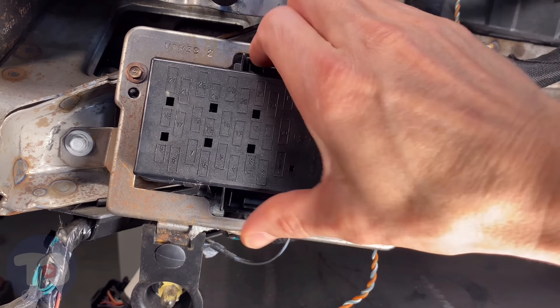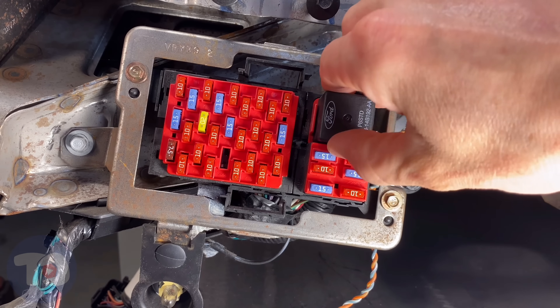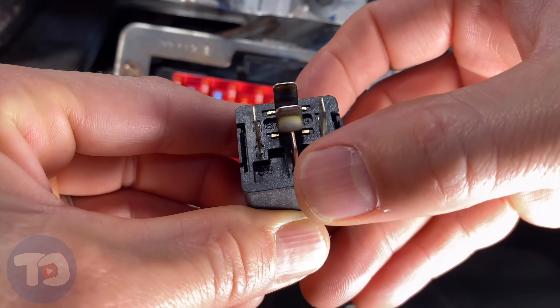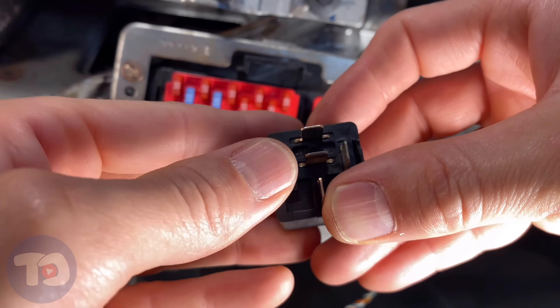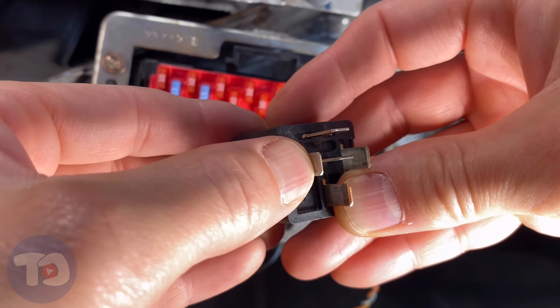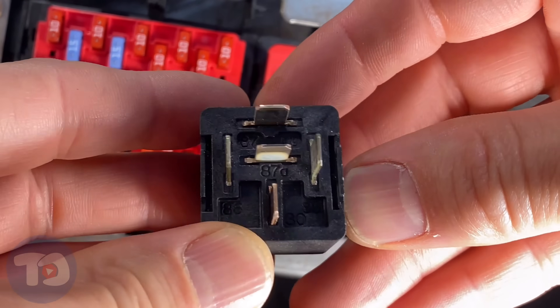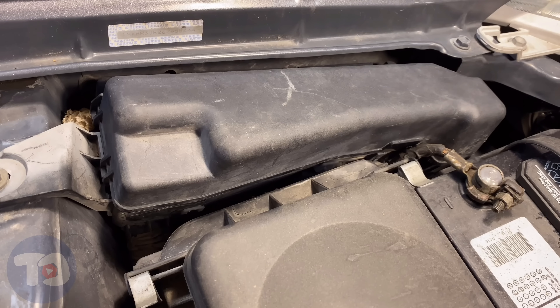In the shop, I have a Ford and a Toyota, which have Bosch and Denso relays, so they're not the same, but they do share the same numbering system. We've got one relay here in this fuse box under the dashboard on this Ford. This is a DIN type B relay, because terminal number 30 is on the bottom and it switches with number 86, that spade terminal there. If they were in the reversed order, that would be a type A relay. Make sure you know what type of relay you're replacing before you put the wrong one in and cause potential damage to computer components that are pretty expensive.